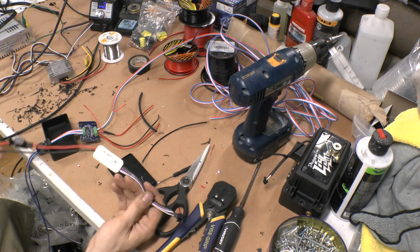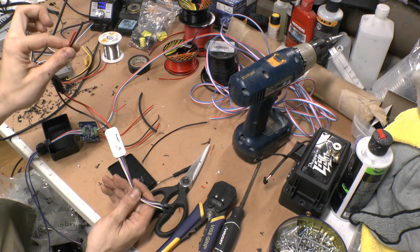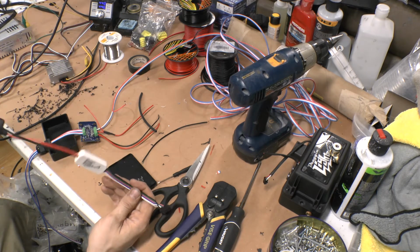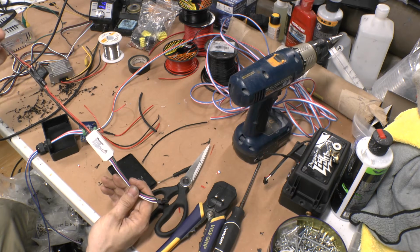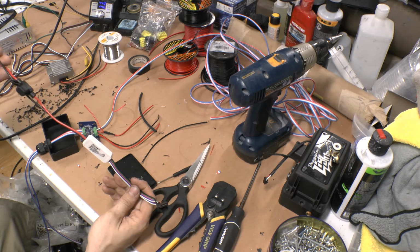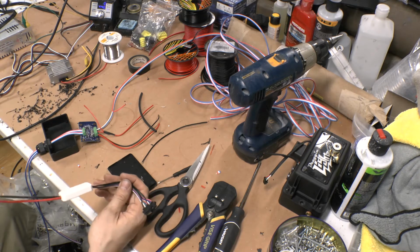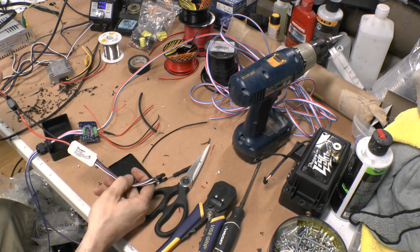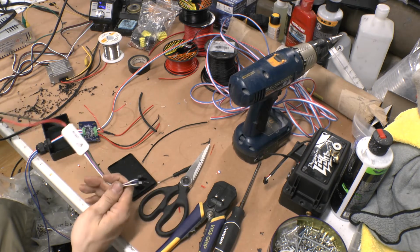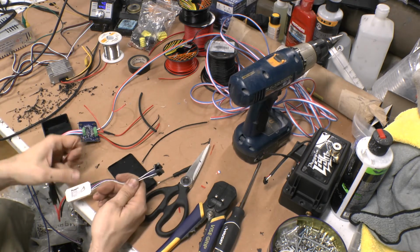They're epoxied on the inside, and all you got to do is strip the wiring and run it to your battery. You can add terminals if you want or whatever you need. It's a really good plug-and-play option if you're not wanting to get the XBT. Maybe you don't need 3 channels. That is a heck of a lot of controller if you're only running a set of Demon Eyes or a Halo. This is a nice alternative to that. If you're running 3 channels, this is not cost-effective at all. But for 1 channel, that's why I had them made up.